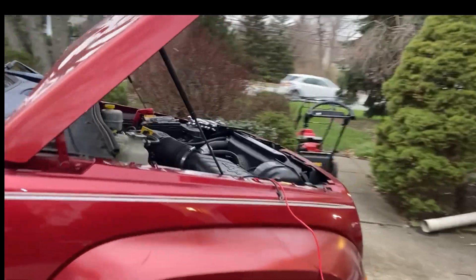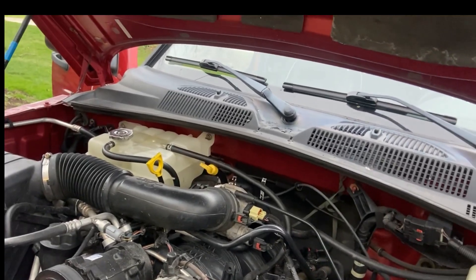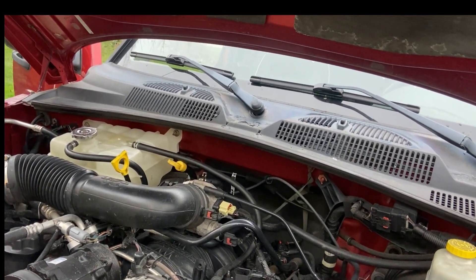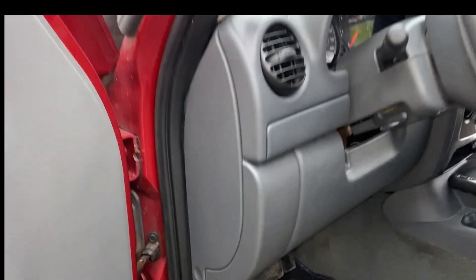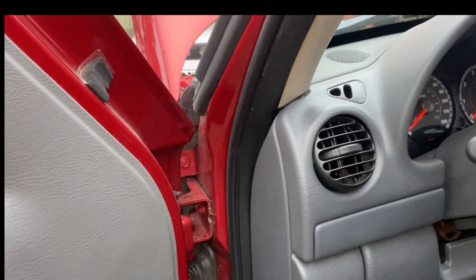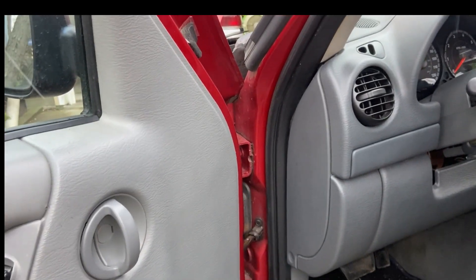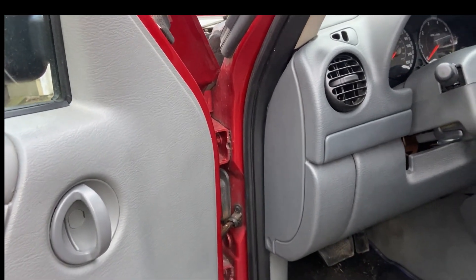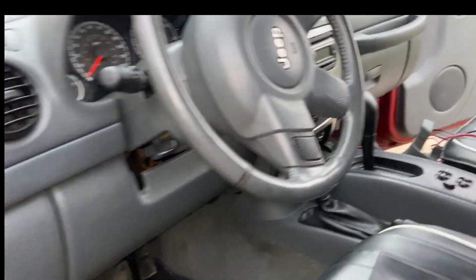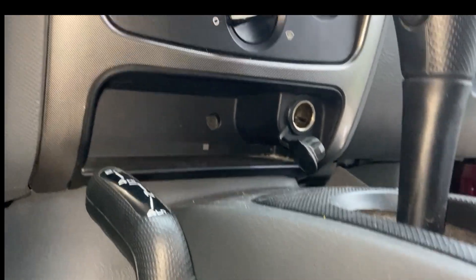This is going to be my solution in place of my regular heater just to provide some heat to get through the winter. This car does have 20-amp receptacles on the inside for this year specifically — that's verifiable through the fuse bank behind the panel on the driver's side. You can check to see what amperage your 12-volt sockets are. The asterisk is that someone could have replaced the fuse with a higher-amp fuse, so you can't just go off fuse values unless they're original. You need to look up in your manual what the fuse size is supposed to be, and that will tell you what amperage your circuit can handle.